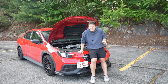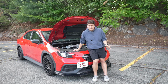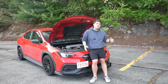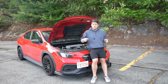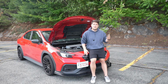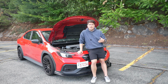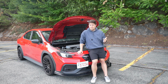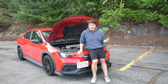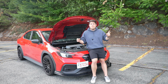You maybe get a little bit of extra noise, but you actually get most of that noise when you tune it. But that's the thing. There are huge reliability issues, actually, if you don't tune your intakes. They're generally safe, but those fringe conditions can cause leaning out, AFR issues, air fuel issues. You can bring too much oxygen and air into the engine cycle, which is going to cause issues with ignition, timing, all kinds of issues, fueling. Is it going to happen often? Probably not. Intakes are getting better at running no tune, but just tune the damn thing.